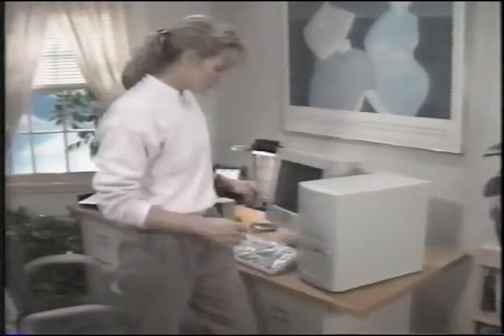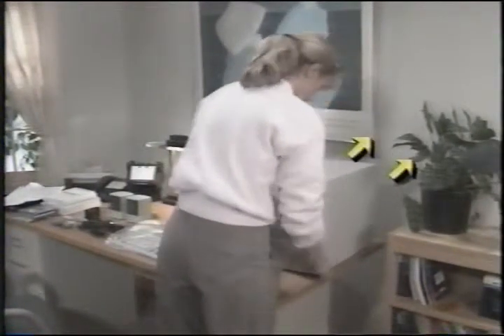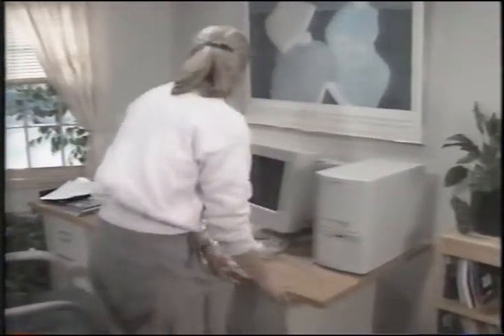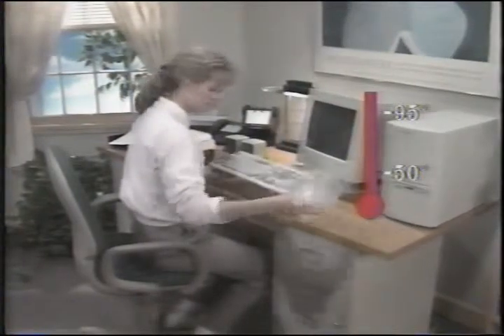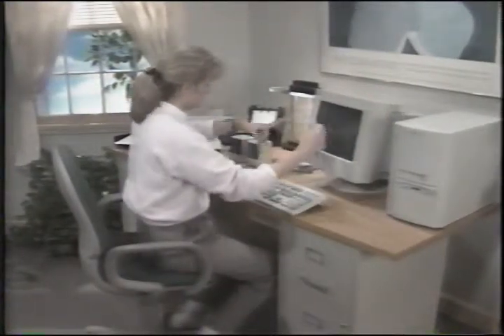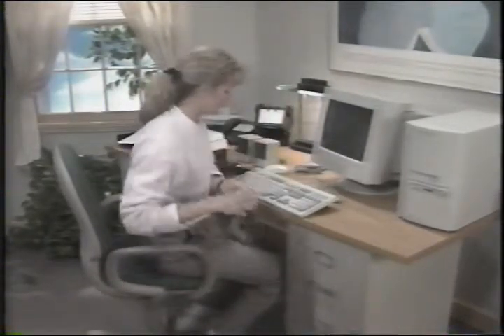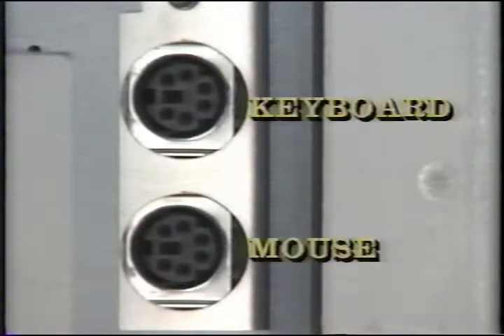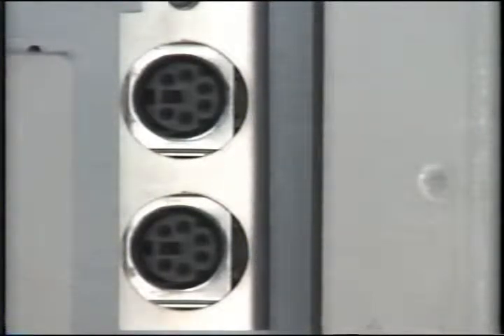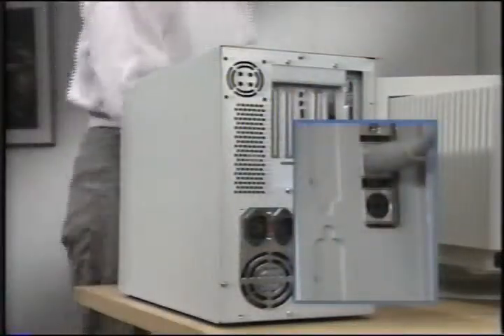Be sure that your system is set up on a flat and sturdy surface, the ventilation holes are not blocked, and the computer is in a location where it will remain at normal room temperature. Let's start by connecting the keyboard — pull off the plastic covering, then locate the keyboard port on the back of the unit. The keyboard connector is the second from the bottom. To plug in the keyboard, look for the arrow — the arrow should be pointing towards the power supply.